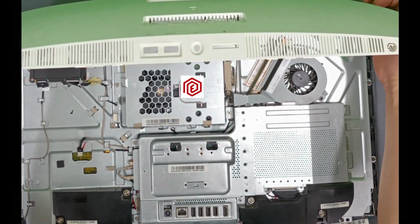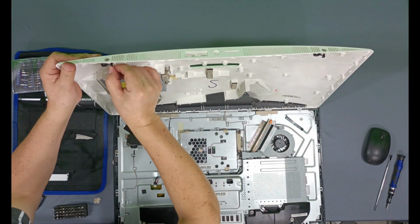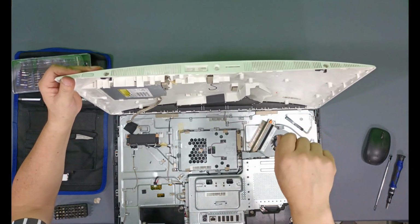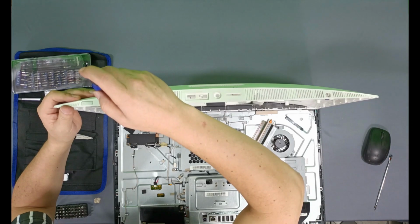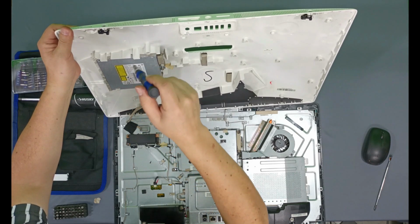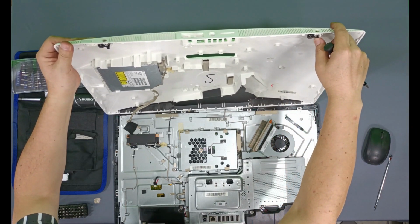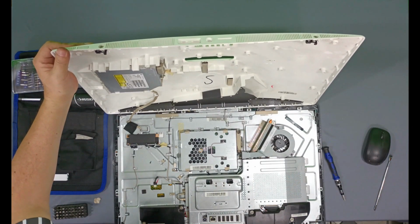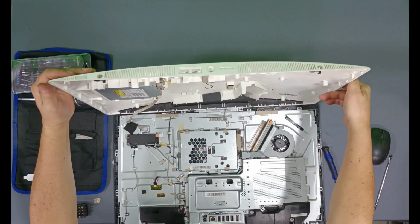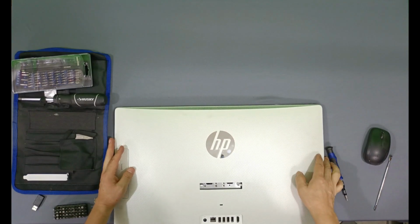And the same procedure before I cover it. I will tell you something. These are the plastic pieces that help secure the cover inside. These are the ones that on the outside seem like a screw. But it's not a screw. It's a latch. It's just a plastic that secures and enters these parts here. But it's only a hook, not a screw. So, if you uncover a computer like this, don't try to turn it like a screw.